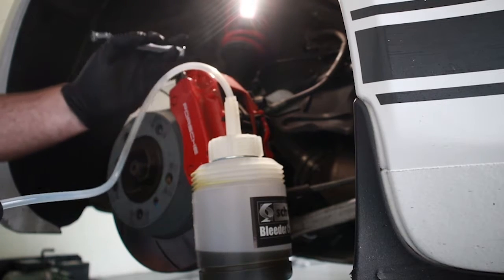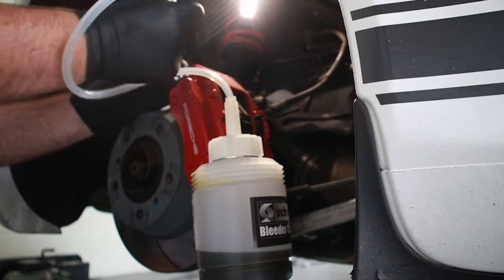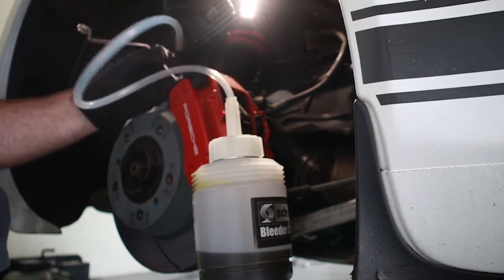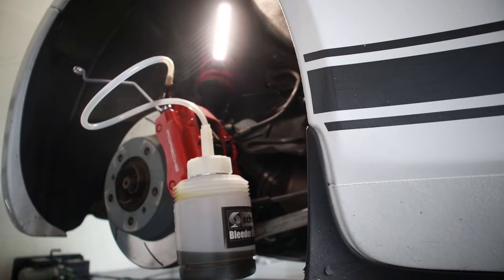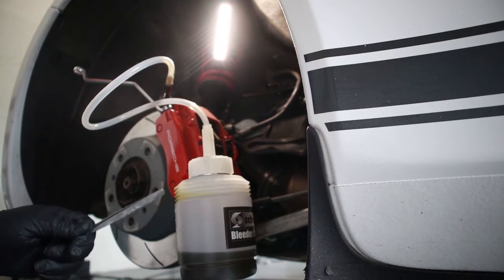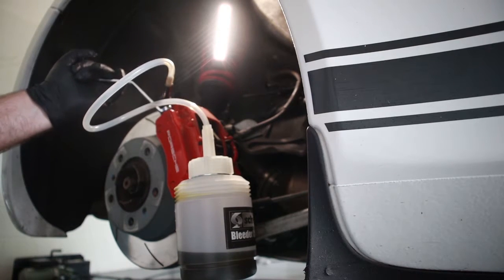So I'm going to set the wrench in here. Make sure this is good and secure on there because we've already had one round of leaks. All right, so we're expecting probably to get up to about 700, 750 from this one because this is going to be the most significant evacuation.